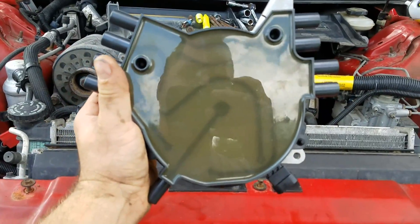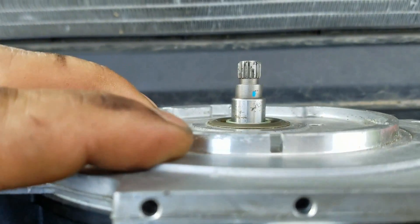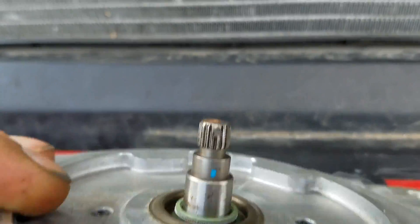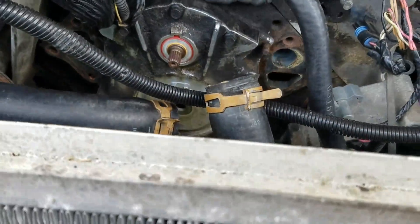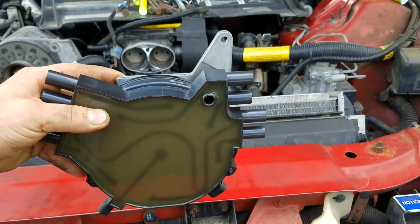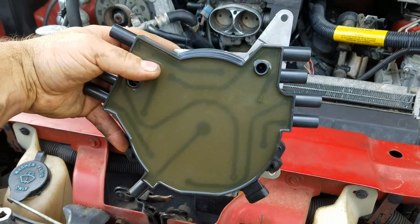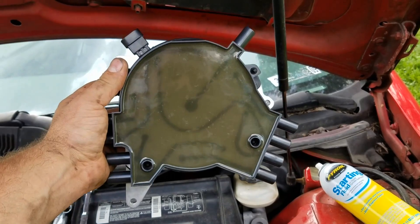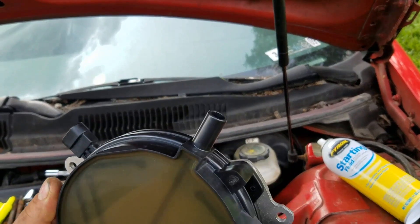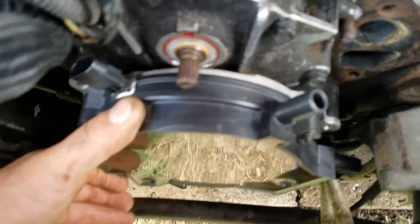Take your new opti — generally the notch is already marked for you. See that blue line? That's the notch you need to line up inside. Once you find it, it should just slide right in with a little bit of wiggling. Don't force it; if you have to force it, it's not lined up. Also make sure you're not putting it on upside down — the opti wire harness and coil plug go on the top. That's what it should look like installed.